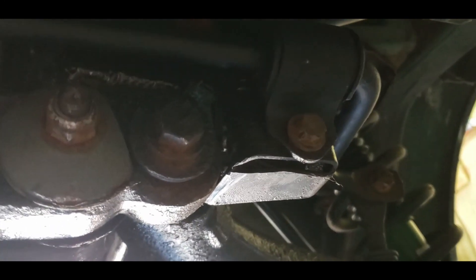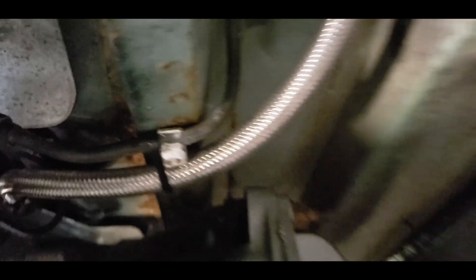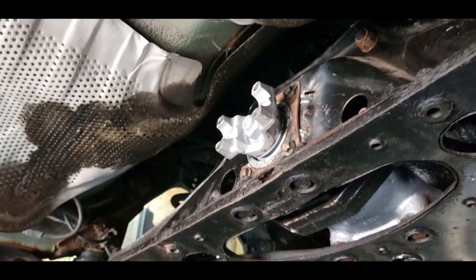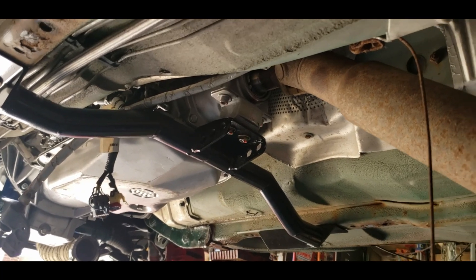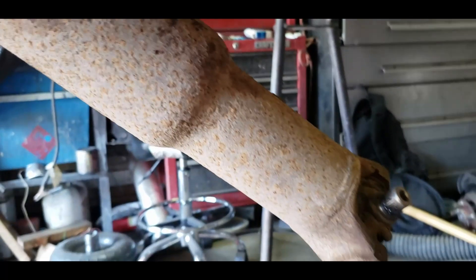Like I mentioned earlier, I ended up welding the sway bar brackets onto the lower receiver piece. Everything fits good. My fuel line clears nicely, which is great because I was concerned about that, so the new fuel system is going to work out. The next big thing will be getting the driveshaft hooked up to the new solid joint. I've got the GM 4L80 in this because it's an LS swap car. The driveshaft I have is out of a Silverado, missing the end caps because I bought it at a junkyard.